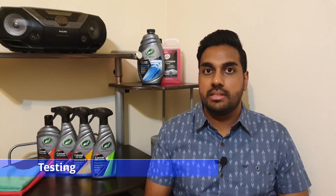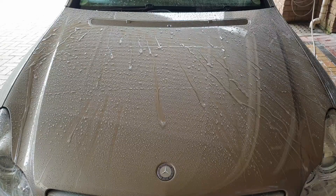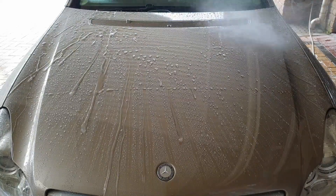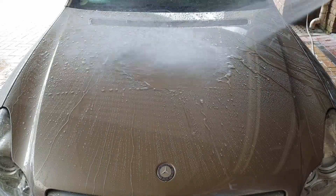At this stage, when you've seen me apply the additional layers of protection, it's only been 24 hours. Just to give a quick overview: all the single layers have had 48 hours to cure from the time of application, and all the sections with two layers had the first layer applied, then 24 hours, then the second layer, and then another 24 hours — just to clear up any confusion. Having a quick look at the water behavior, they're all doing very well. The places that have wet wax on top seem to sheet water a bit more than beading, but regardless they are all quite good. If I had to pick a winner for beading, it would be the two layers of ceramic spray coating.